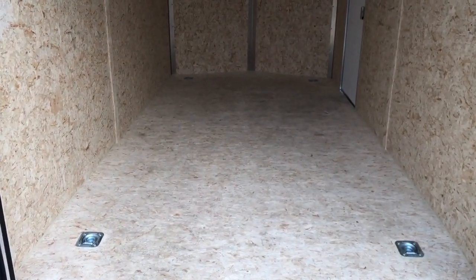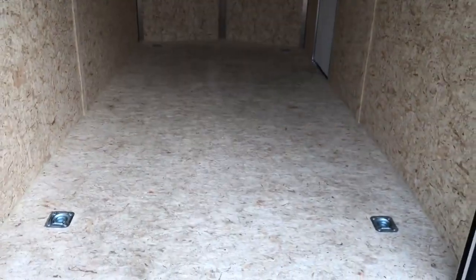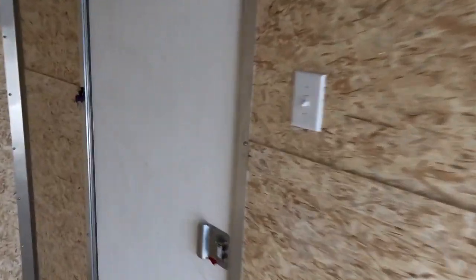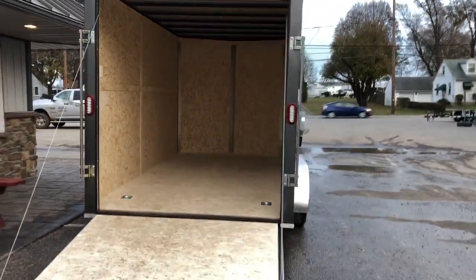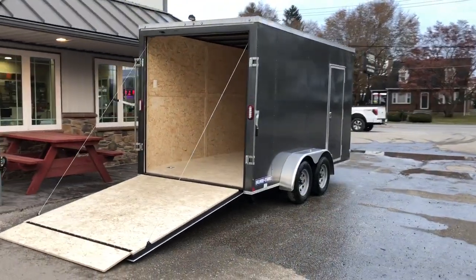Part of the UTV package is also four tie-downs into the four corners. This particular unit has 3/8-inch walls and 3/4-inch floors, tube sealing studs, and a dome light with a residential-style wall switch. It's got a solid door and a light at the rear as well for loading. A unit like this is going to weigh in at about 2,200 pounds and give a net legal payload of about 4,800 pounds plus your tongue weight.